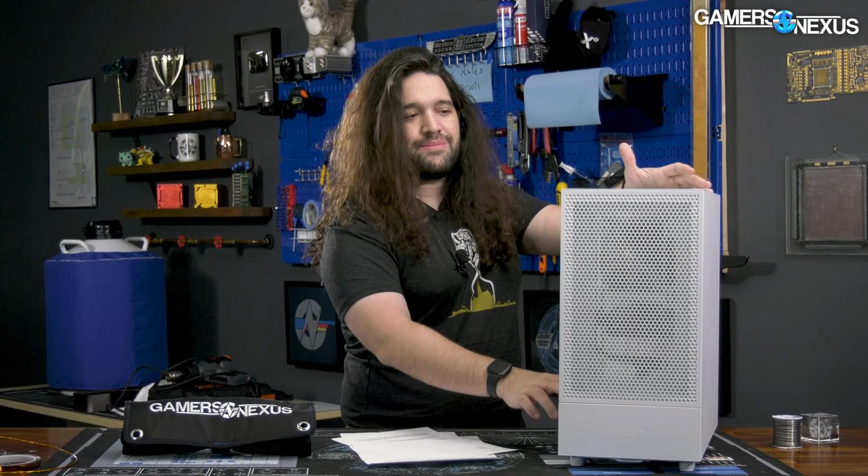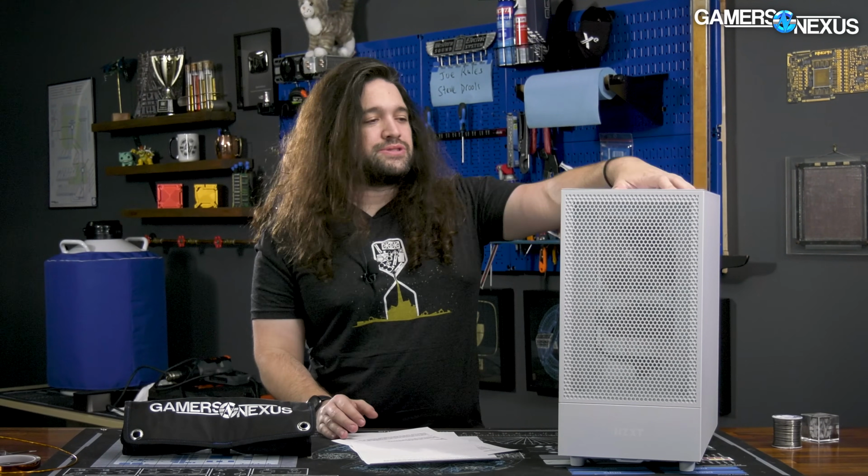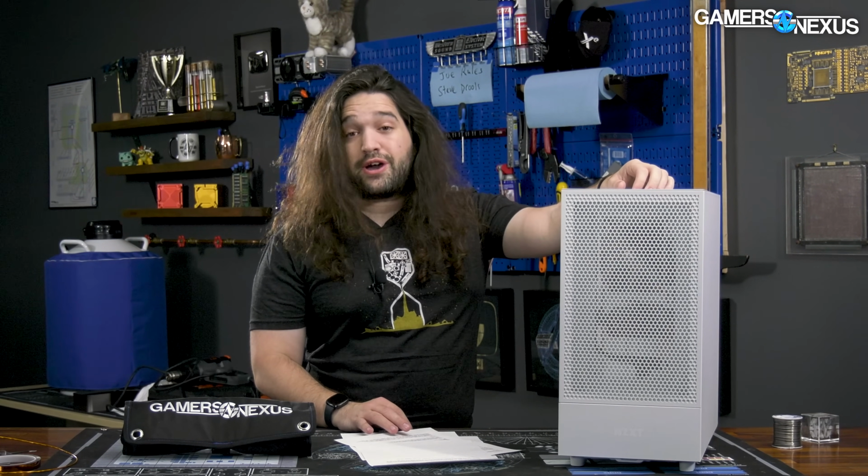You're kind of left at the bottom. You can get some in through the top. That would be sufficient for mid-range builds. And although people aren't used to top intake because hot air rises and therefore it feels kind of weird, you're directing the air with fans that are far more powerful than the energy exchange of rising air, and so you're fine. It'll work well. It does just fine for cases where you don't have many options.